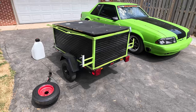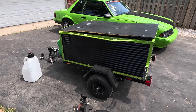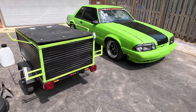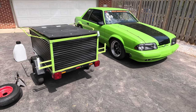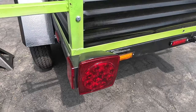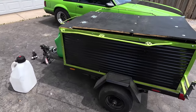As far as lighting, everything was LED. I tried to do that to keep the current draw low, especially for night driving — you have additional lights and a little bit more electronic usage on the car, so we wanted to make sure the draw on the alternator wasn't as bad. The little rectangle lights came off Amazon — I can put a link in the description. Same with the taillights, which originally had incandescent bulbs. It may not have made a huge difference in power draw, but definitely something to consider.